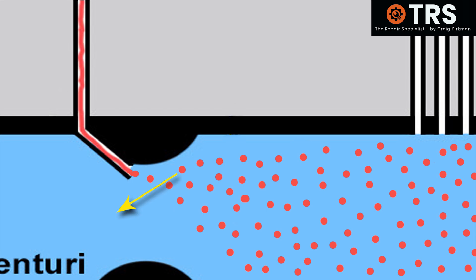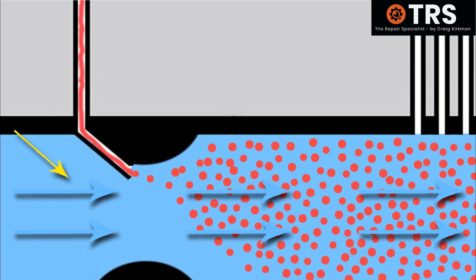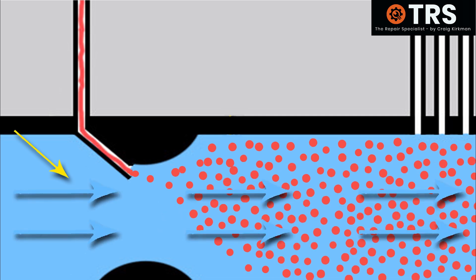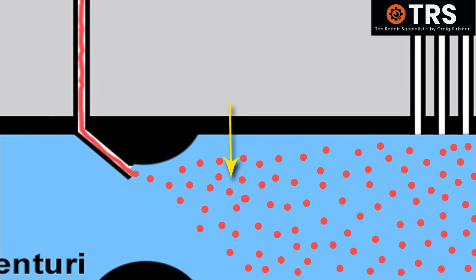Let's say this carburetor is preset to allow only a certain amount of fuel down through the main jet into the induction tube — so the fuel is constant. The issue, which most people don't realize, is that the air coming into the induction tube to draw out that fuel is anything but constant. I don't mean just the variation between maximum RPM and idle — those varying speeds should bring out the right amount of fuel. I'm actually referring to other factors that affect the air itself, such as temperature.